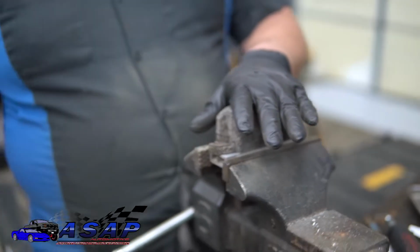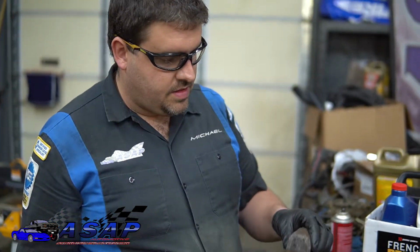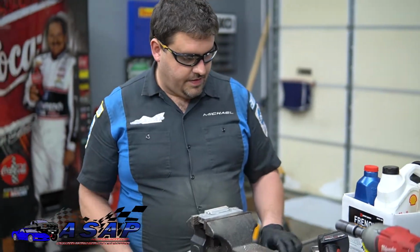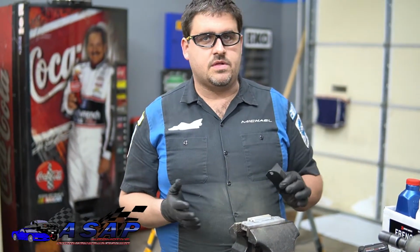And these, like I said, they ride on the bump stops a lot more than your average vehicle. So it's important to have a good set of these. What we're going to do is away with these since they're so rotten, and we're going with these rubber replacements. Like I said, you can do urethane if you want. In a car like this, we obviously went with rubber.